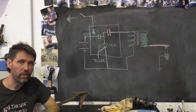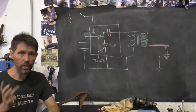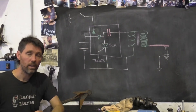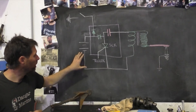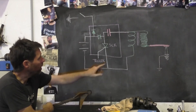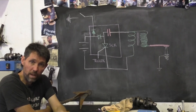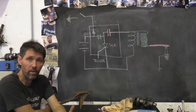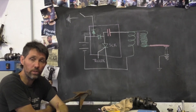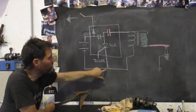Presuming your kill switch is in, this switch is open and the current can flow through and start charging the capacitor. Because of the diode, if it's an AC coil it won't charge-discharge, it'll just keep charging every time it gets a pulse in the correct direction. At the end of the day, the capacitor ends up holding current at a reasonably high voltage — certainly above your battery voltage, in the hundreds of volts. Much like the points in a distributor, we then have a unit called a silicon-controlled rectifier, which is essentially a switch controlled by another current, like a transistor. In this case, a trigger coil sends a little current in, and when it does, this SCR closes so the switch turns on.